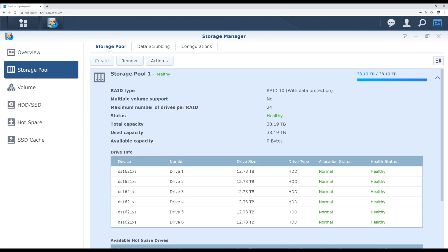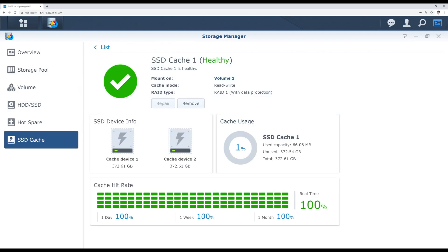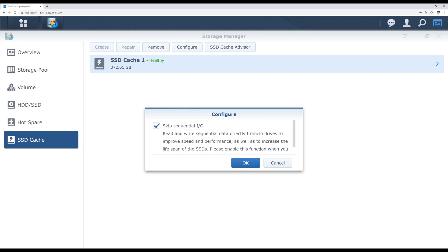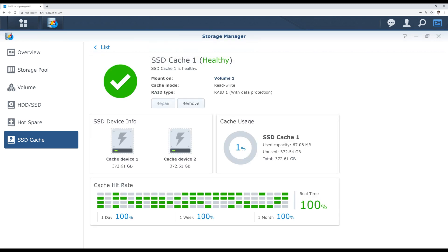We made a RAID 10 storage pool and a volume on top of that, and to show how you'd get a cache set up, we have a RAID 1 cache group across our two devices with a little bit of activity on it. You can do some fine-tuning to cache management by having it skip or not skip sequential IO. Generally in a production setting, allowing sequential IO to hit your hard drives is probably preferred since they can absorb that really well. Although if it's day one and you just got this deployed, unchecking that to allow more IO to get things into cache faster might be preferable — and you'd probably save yourself a little endurance on the drives by skipping the sequential IO writes over time.